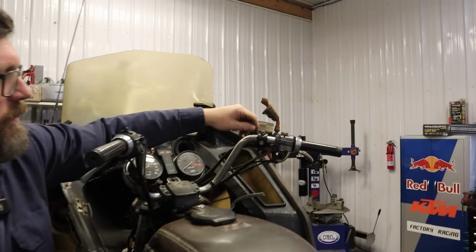We just bolt them heads back down in there. I mean, we'll be fine. One of the really neat design features of this bike is these cylinder heads are turned at a 22 degree angle. The reason they did that was to tuck the carburetors in a little bit so they weren't in the way of your legs. And it also brought the exhaust out in a way that made the bike look really, really cool. Way to go, Honda.